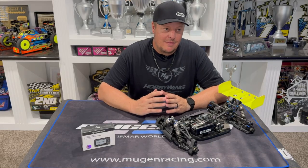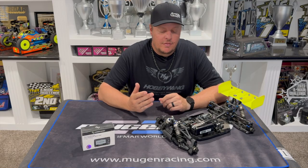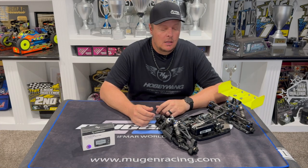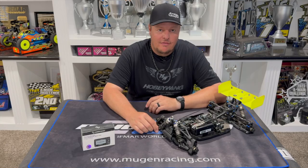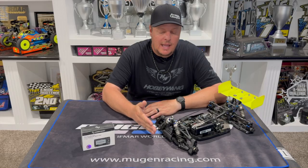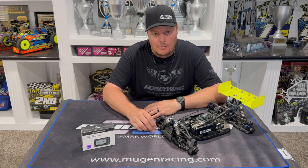I used to think you always want the brakes to be really smooth. What I learned from testing was that when you turn the brake force down, that also makes the brakes smoother — but if max brake force is turned down and you run a high frequency, it feels like you have no brakes; you just don't have as much feeling. Lowering the brake frequency brought that feeling and precision back, but when you make it more aggressive on the frequency side, you may need to reduce the maximum brake force.